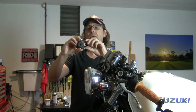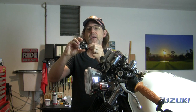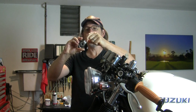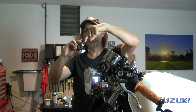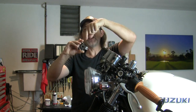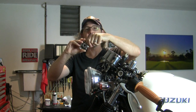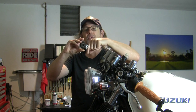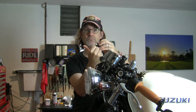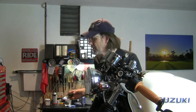If you're rotating on a circle and you're already too short, well then when I pull the cable, I'm kind of pulling away from the circle rather than in a nice tangent to the outside of the radius, if that makes sense, and getting the maximum amount of push on the push rod into my clutch mechanism. So cable length matters. I don't know if that all made sense to you.